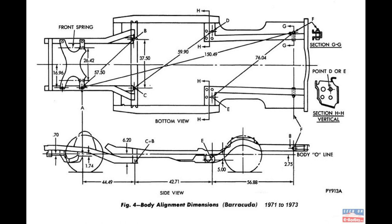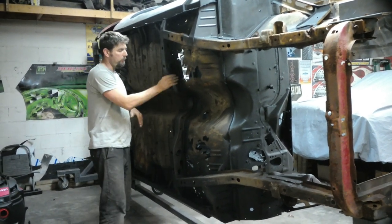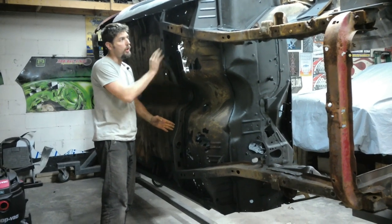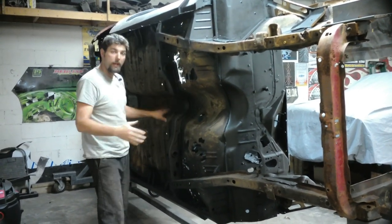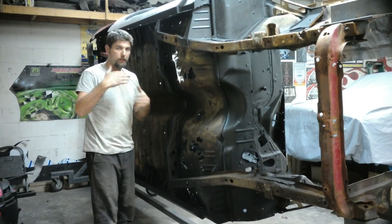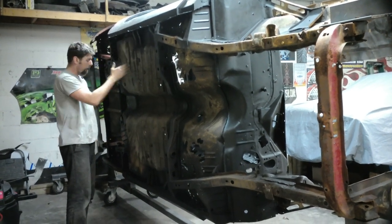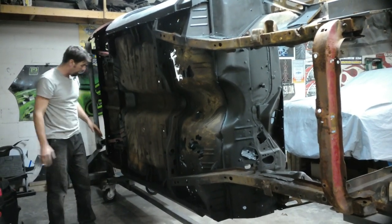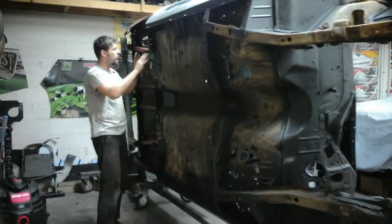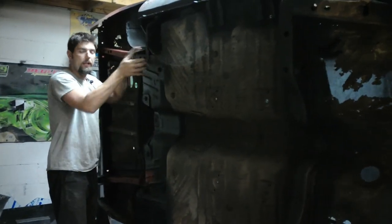There are a lot of similarities between these two frames. It's mostly the wheelbase difference in the center. The torsion bar cross member on the Barracudas and Challengers are going to be the same, and everything frame-rail-wise forward — all the measurements are the same. The floor pan, same. A lot of parts, same thing. Where we start getting differences is right where the toe pan section is. The rockers are different and you've got two inches difference there. The main frame rails are the same; they're just located two inches back.